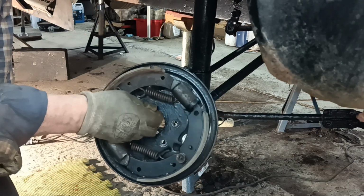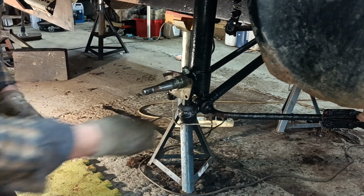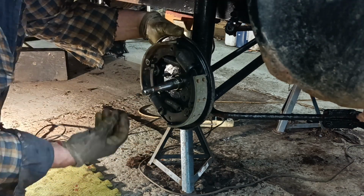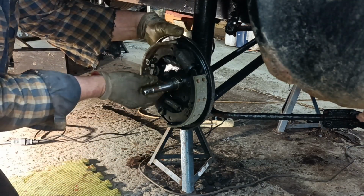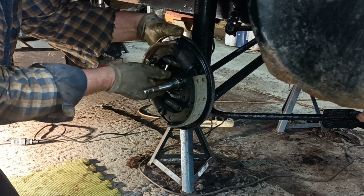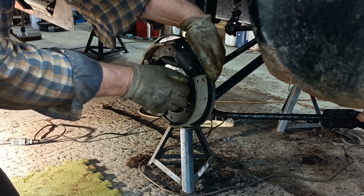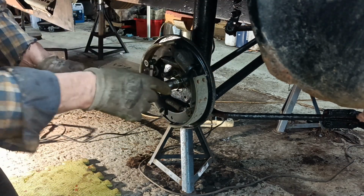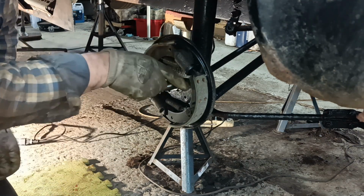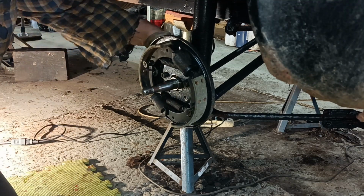Okay, let's see about getting this in place then. I'll pick the bolts that have got the correct early style lock nuts, you know, the all metal lock nuts. Twin leading shoes, so you go look for the direction of rotation. The piston pushes forwards, yeah, with the rotation.